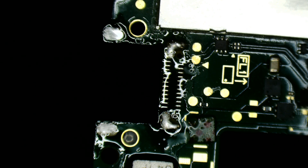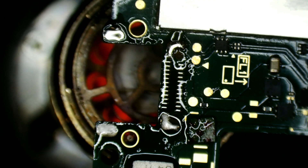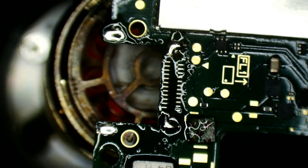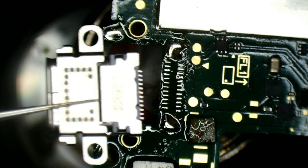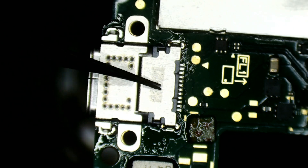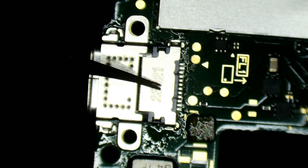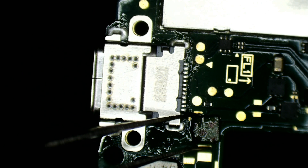Now I'm going to take a brand-spanking-new charge port and do the same again but in reverse. Heat up the area — you'll start to see the solder sucking on those ground holes. I'm just waiting for the solder to fully flow all the way and then I can just drop the port on and start moving the hot air around, which will prevent the plastic from melting. Push down on the board and then release the hot air, and hold that port down while waiting for the solder to solidify.